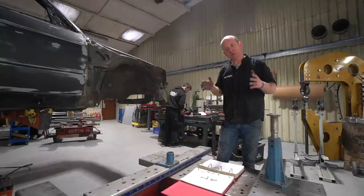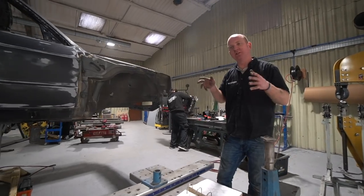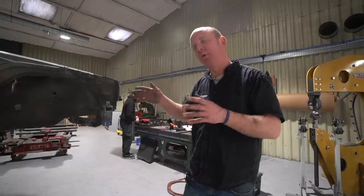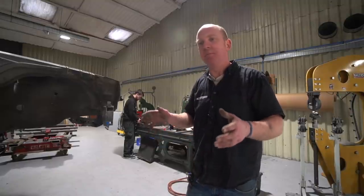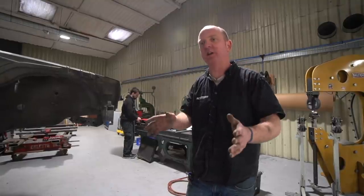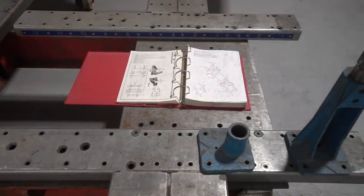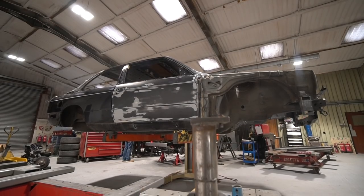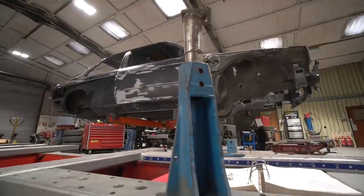It's quite time-consuming to attach the car to the jig, which is why the crash repair world has moved away from it somewhat — it's quite expensive. Select jig benches tend to be aimed more at high-end, more expensive vehicles where the longer repair times can be justified. But once the car is fixed to the jig, it's extremely accurate. The fixtures won't align — they simply won't connect to the suspension parts — if something is out of position. So that's your first indicator, and you can then use a measuring system to find out how far out of alignment things are.